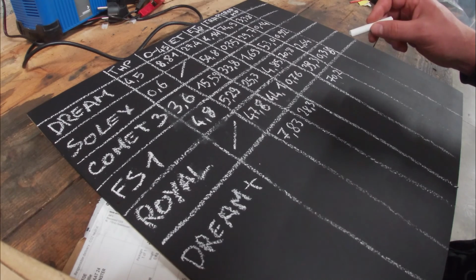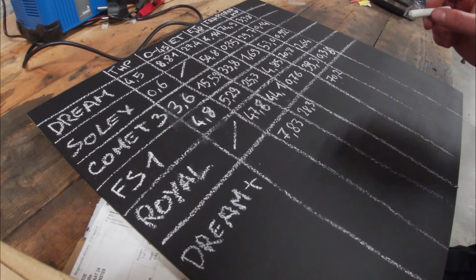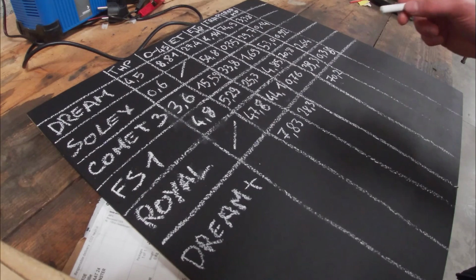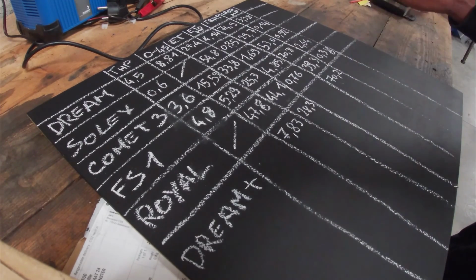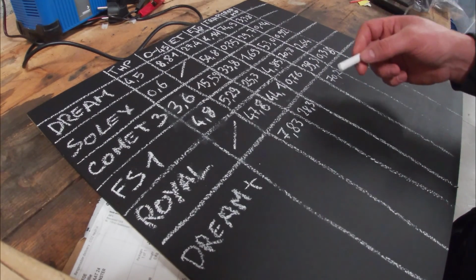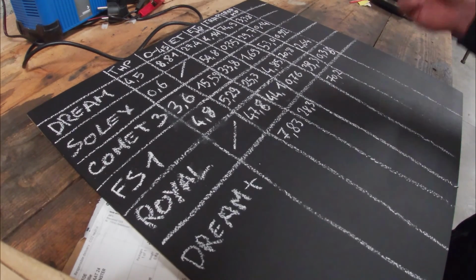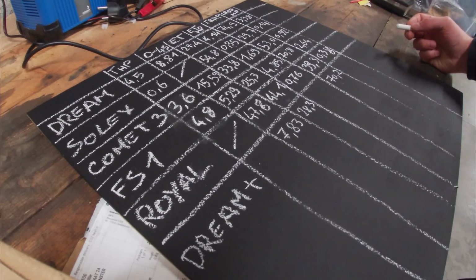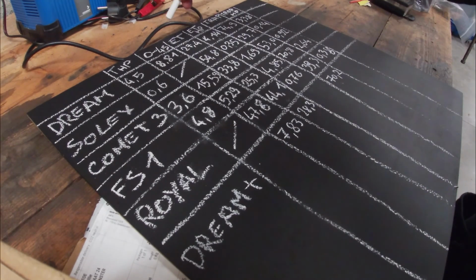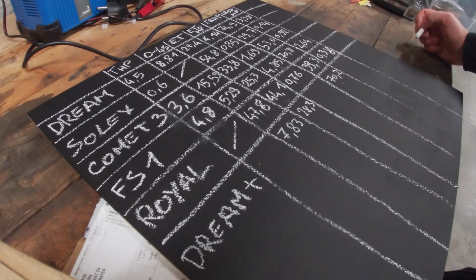That's kind of strange. I'm just checking the data again, and for the 8th mile, so half a quarter mile, it's actually nearly identical. So it's kind of strange. The 0 to 45 that was measured is actually a second quicker, but with the quarter mile, the 18mm carburetor is actually slower, which is pretty strange. Either we had a lot of wind up front in this run, which I doubt, or we had a lot of wind in the back on the original run, which I can't remember. So the conclusion of this test: is bigger also better? Well, in this case, not really.